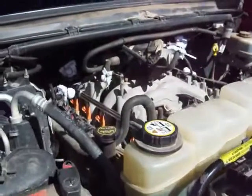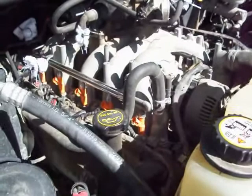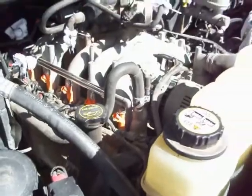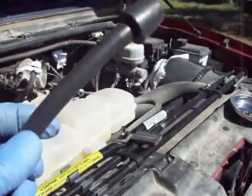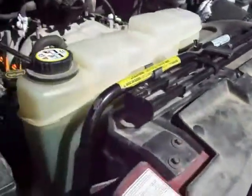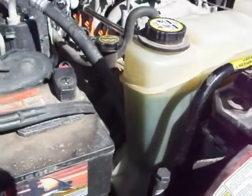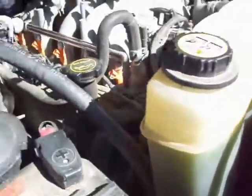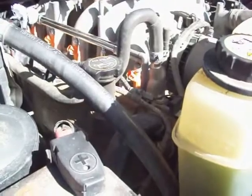We were talking about how to decide if the valves were closed and where the piston was on this Triton V10 engine when we're about to do a spark plug insert. We need to make sure the valves are closed. The way we did it was to put a plug in the spark plug hole hooked up to some air, put in maybe 10–20 PSI, crank the valve open just a little bit, then slowly turn the engine over with a breaker bar and an 18mm socket on the crank until the valves close, the cylinder seals, and the plug pops out.